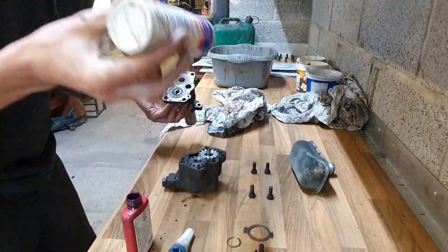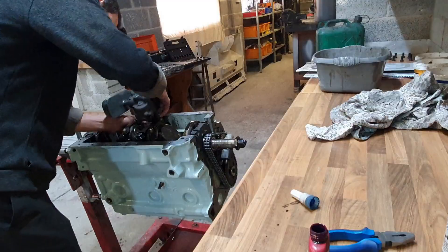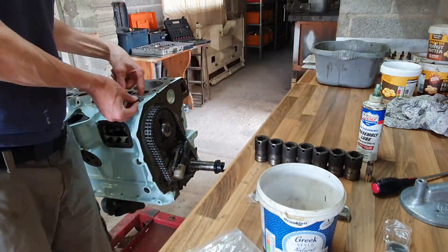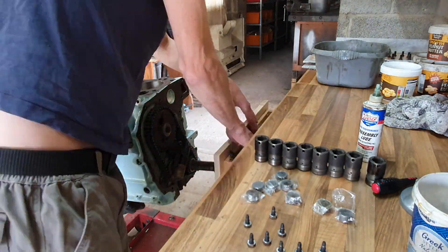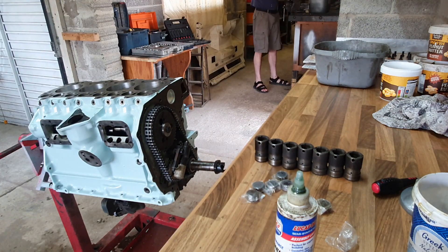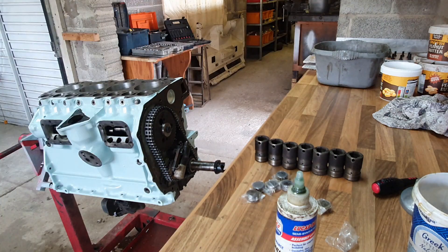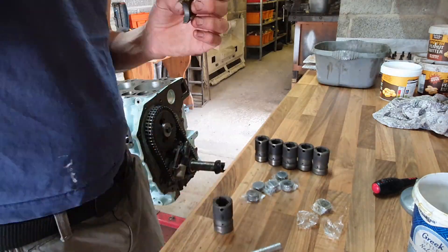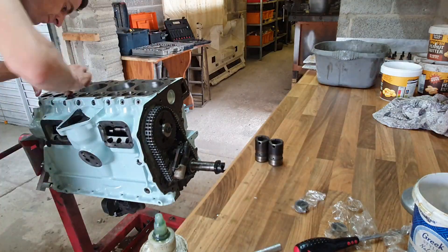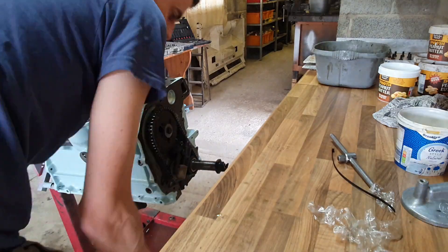It's quite a good oil pump, and it's immersed in oil so it doesn't need priming — it should pump oil pretty much from the get-go. Bolt that all up, and now we're on to the followers. These are the old buckets being reused with new followers; the part that contacts the camshaft is being renewed. You can see the discs — they look like little hockey pucks. I use a cable tie to hold the whole assembly together while I drop it in, then pull the cable tie out before putting the little retaining bolt in place.